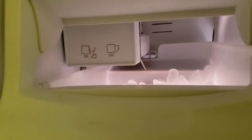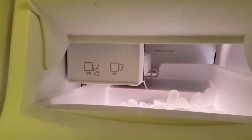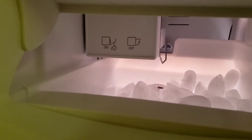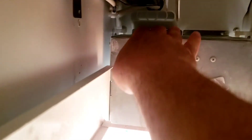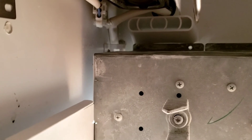It's a few days later and I've seen that the fix worked. As you can see, it's got plenty of ice. There's no more ice buildup down here or around that plug in the back, and there's no water leaking. I believe the leak was somewhere between that chute where the water comes down and into the ice maker — right in between there. Putting that PVC pipe over the water chute covered the leak, and now it's all going right into that little box and into the ice maker — working great, no more leaks.